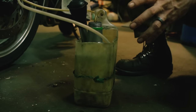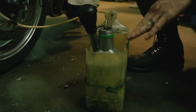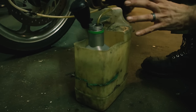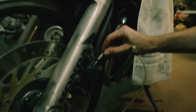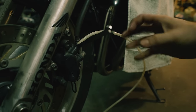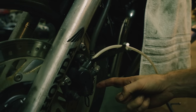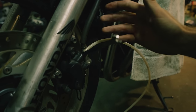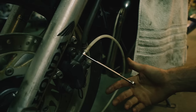The brake bleeder system is really simple to use. You can take an old plastic bottle, fill it partially with water or brake fluid, and run a hose straight into it — super easy to make. Run the hose right onto the bleeder valve of your brake system. Sometimes they have two bleeder valves, so it's important to know which one you want to bleed. Sometimes you have a split system with a rear brake hose operating the same caliper — check your manual. This is a single-hose caliper, one-sided on one side of the disc. It uses an 8mm wrench to crack the bleeder loose.